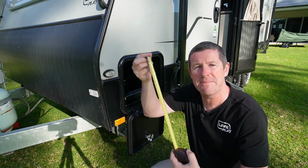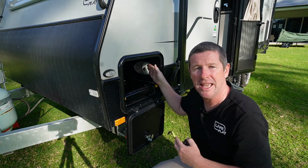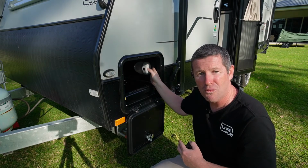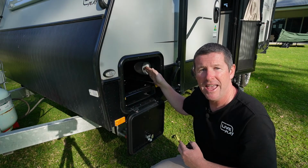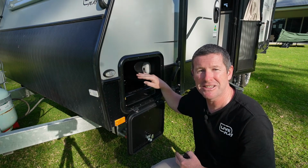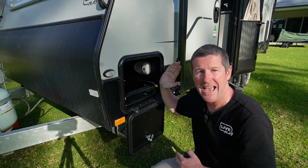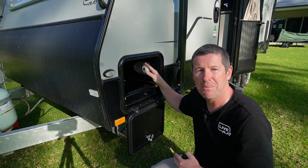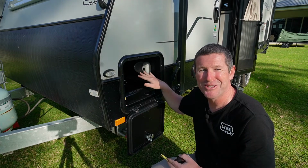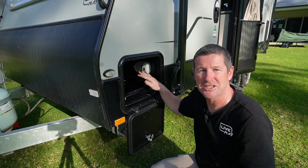So I got the handy tape out and I measured roughly 70mm from the edge here facing the rear of the van to the rear of the tunnel boot itself, and made sure it was roughly the same all the way through. It's a little bit hard to do because the acrylic liner does actually have a little bit of a wander in it, but even going by the eye, it's roughly pretty much square and nice and true in the hatch itself.